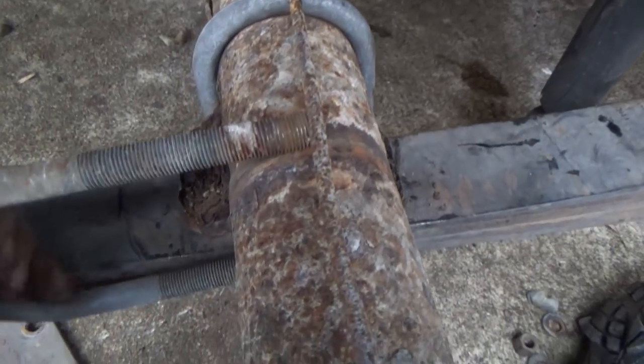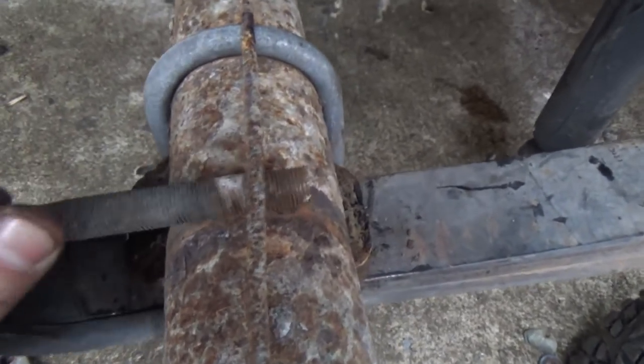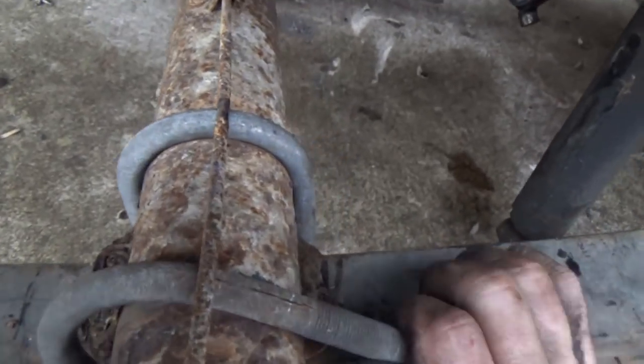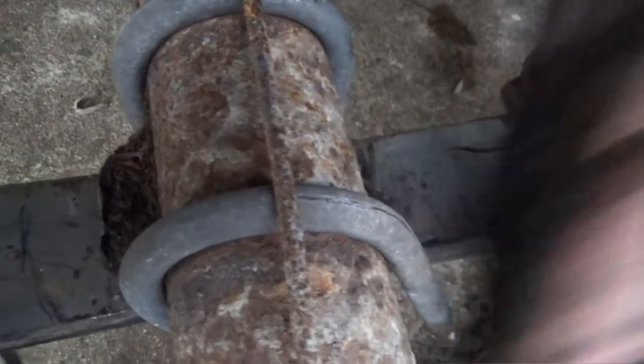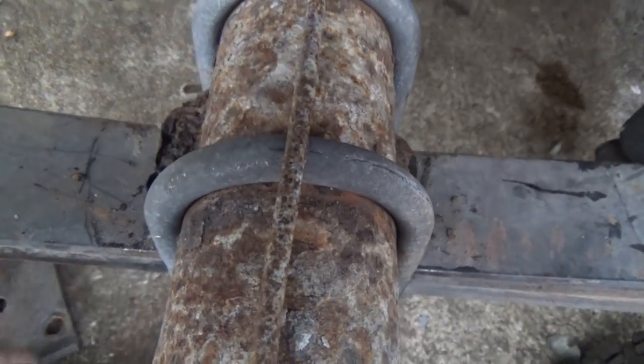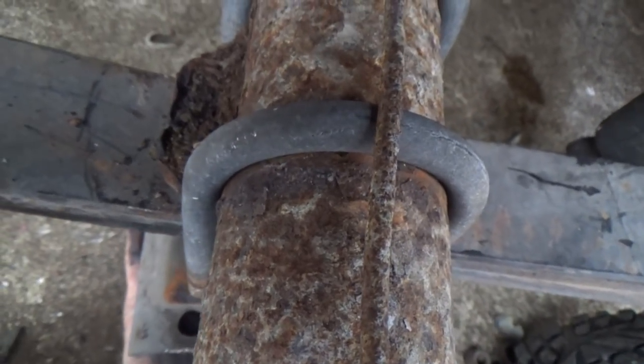Okay, putting the U-bolts in, take them and put them in like this, up at an angle. Get them under your brake line. Tap them in. Once you get them tapped in, rotate them down. Rotate, dang it. Then there you go. Now we can bring a plate here, bring it up, put them in the holes, and put the washers and nuts on.